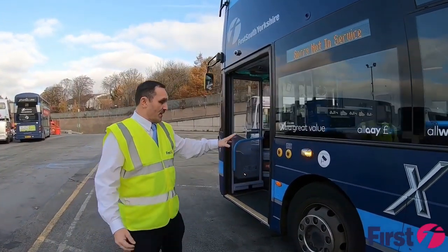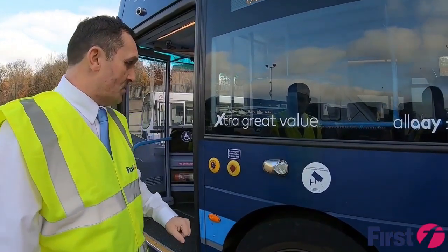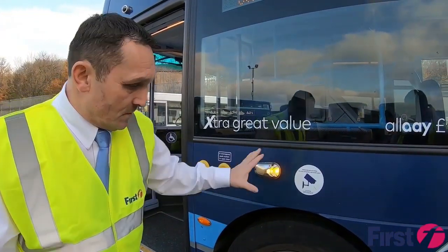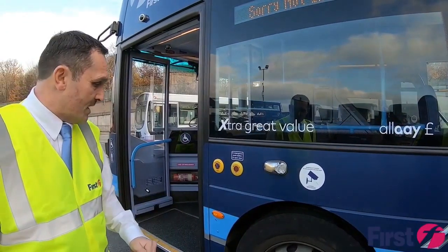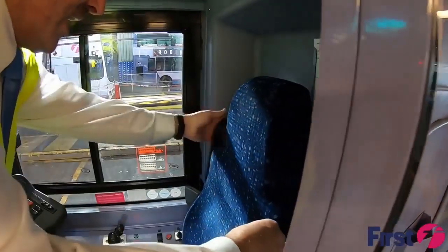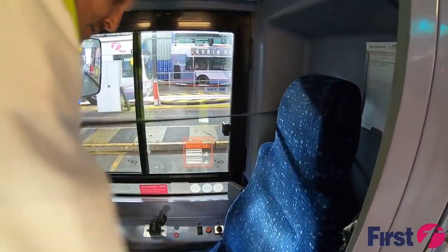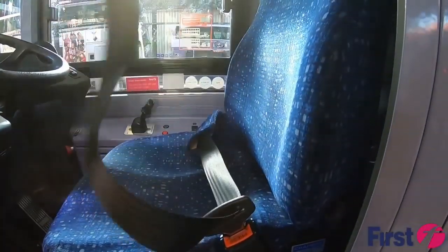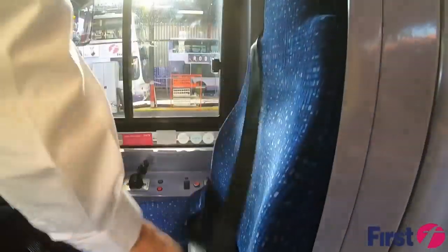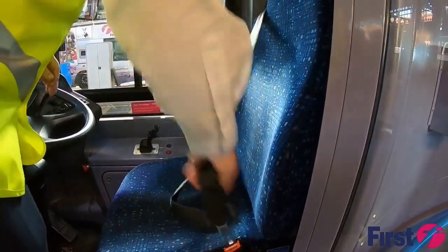As we come down to the final part of this outside check, making sure that side indicators are working and that the spare tyre is not damaged and it's got sufficient tread depth. So I can check to make sure that there's no fraying in its seat belt and that it secures into its holder, and making sure that it's secure at all connection points.